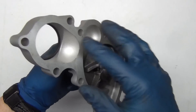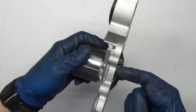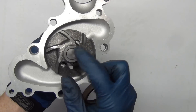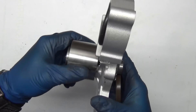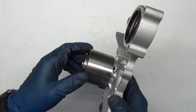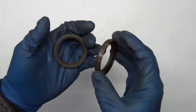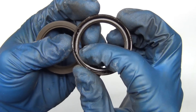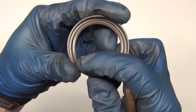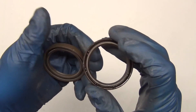This is the water pump — it turns the antifreeze and seals everything off. One side is turned by the timing belt, so this side is in the air and this side is in the coolant. What keeps the coolant from going where the air is? Seals. This is a camshaft seal — there's a smaller seal about the size of that shaft, and it causes the antifreeze to stay in the engine even though it's spinning. You've got camshafts, crankshafts, water pump shafts, power steering pulley shafts, an AC compressor shaft — all with seals on them. This is the new camshaft seal. The old one is just pretty well cooked — it still moves, it's not completely failed, but it's really stiff. A soft pliable seal will seal much better than one that's petrified like a rock. They get so bad they'll crack and break apart and crumble like that paper gasket did.